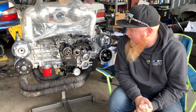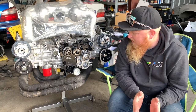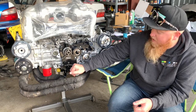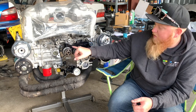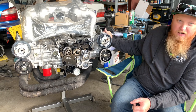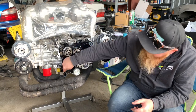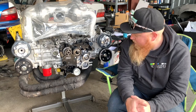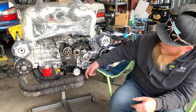We reached the end of the day and got everything off the table - with the exception of maybe my oil relocation kit and a few gaskets - and onto the engine. The kit we installed today was the Roger Clark Motorsport Dry Sump Kit, which typically comes with a water pump, front cover, seal, hardware to install the oil pump, a cover that blocks off the original filter since you'll be filling through the dry sump tank, the pressure line, the race filter, the block-off plate, and the nub in case you're running the factory water-to-oil cooler.